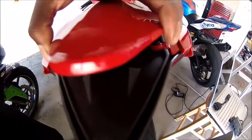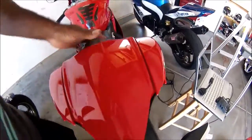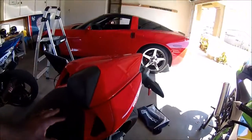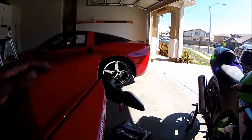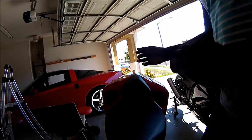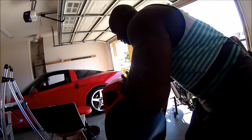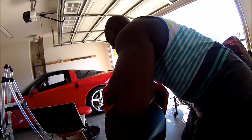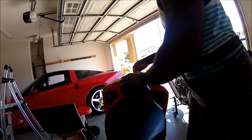Back here is the indentation to put the cowl. A lot of people have lost their seat cowls because they don't install it correctly. What I like to do is get that indentation in there, put my hand here and my hand at the back of the motorcycle, and listen for that loud click. Then I press it again and shake it to make sure it doesn't come off.